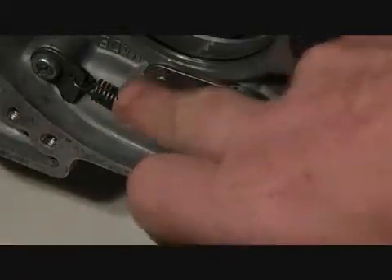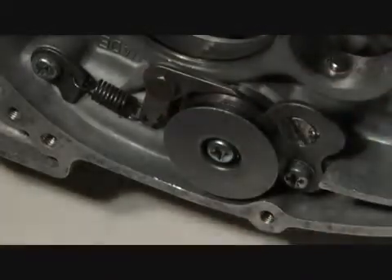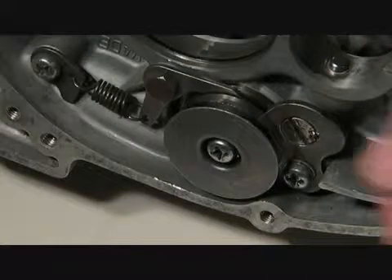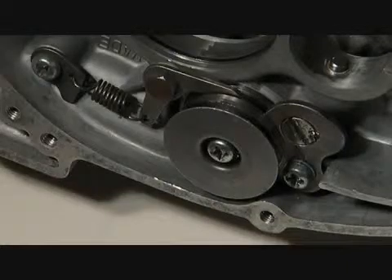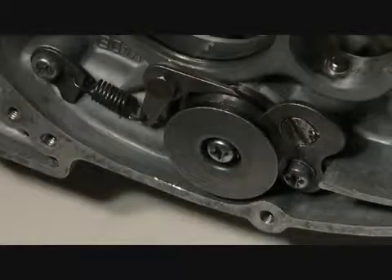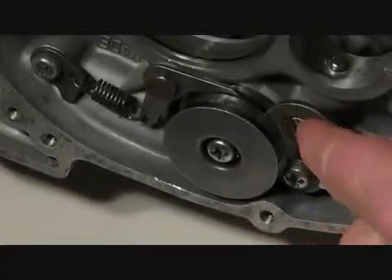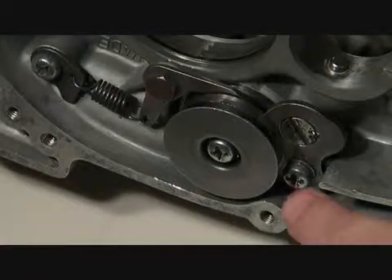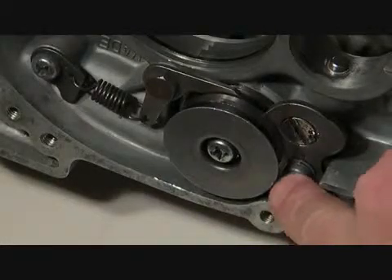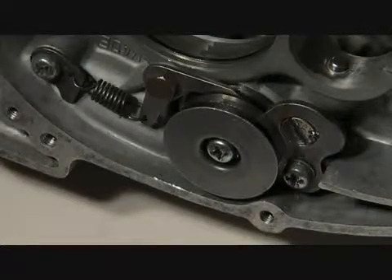It's very important that these stay tight. I clean the bolts really well with carb cleaner to get all the oil off, and I also use carb cleaner in the bolt holes — the screw holes — with a few Q-tips until they're totally clean. Then I'll use blue Loctite on all three of these. Make sure these are Loctited because there's no locking mechanism on the countersunk one. There's an inside star washer on the Phillips head, so you have basically a dual locking mechanism.